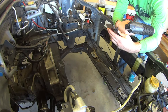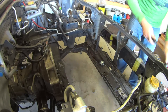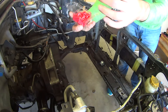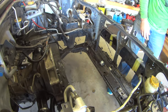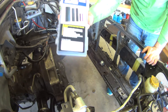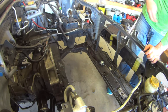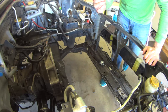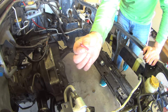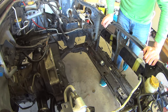To modify your transmission wiring, or any wiring, here are some general tools you're going to need. I'll be using my heat gun, some wire cutters, and some butt splice connectors — these particular ones are 22 to 18 gauge. Then, as always, I've got assorted heat shrink. Since this wiring is external to the car and water can splash up from underneath, that heat shrink is going to be very important. These butt splice connectors are not sealed, so if you don't have sealed ones, you definitely need to use heat shrink — getting water in those connectors is just asking for problems.